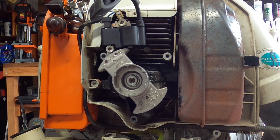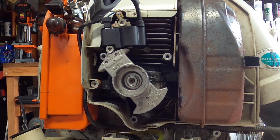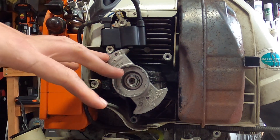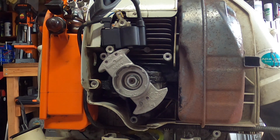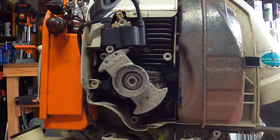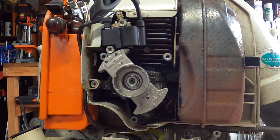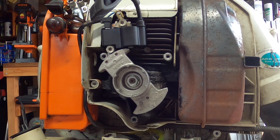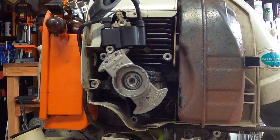Go ahead and cinch it back down to ten thousandths and your spark will come back nice and strong. This is the same for pretty much all machines — the mounting and coils will look different but the idea is the same: ten thousandths of an inch gap between the coil and the magnet. All you need is a screwdriver and a piece of paper or a business card, or a feeler gauge if you want. Subscribe and follow me on Instagram at smallengine101, and leave a comment below if you have any questions.